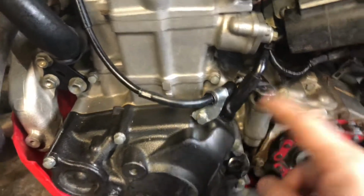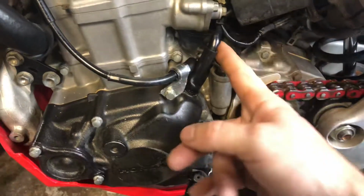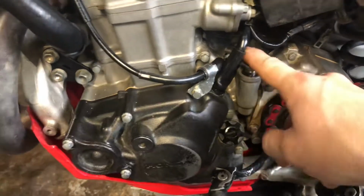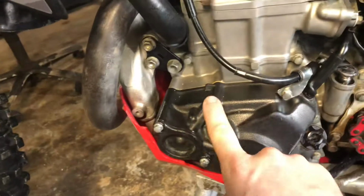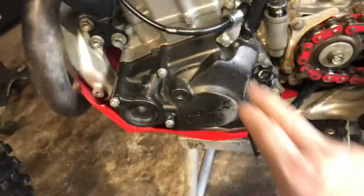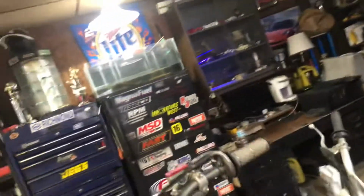I think the 2015 clutch armature would work. It sticks up a little higher, and it's angled right. But I couldn't find one cheap anywhere on eBay, so I just bought another '13 that popped up for cheap, and cut it and welded it. The bracket usually goes from there to there. I just cut it. It would have worked, but I just didn't like it going out there. Using this made the clutch pull quite a bit easier, even compared to the other clutch cable oiled.